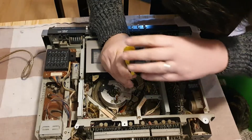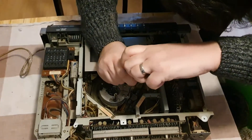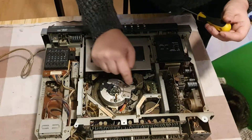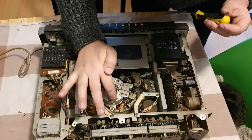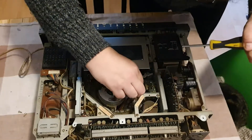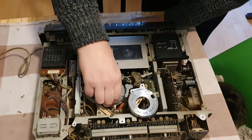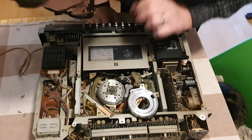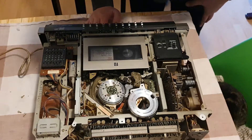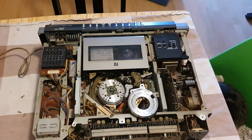I'm going to first off remove this upper head drum and get it out of the way. From what I can tell there are two screws which hold the bracket to the actual head drum itself. This I would guess is a moisture sensor, and these hold the drum in place. Moving that out of the way, we have the head disc and the head disc is still stiff. The heads themselves I think are okay, which would suggest the stiffness is actually coming from the motor assembly on the base.